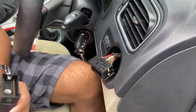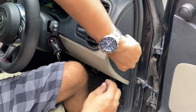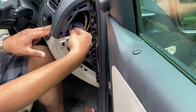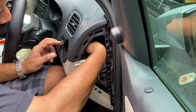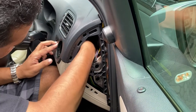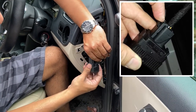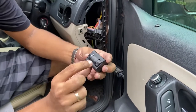Now to remove the headlamp leveler switch, you need to access the side panel of the dashboard. There's a connector here, and there are tabs securing the adjustment unit. Press it from the front and it should release itself from the locking tabs. Pull it out, raise the tab, and pull the switch out. Once again: raise the tab, pull the switch out.